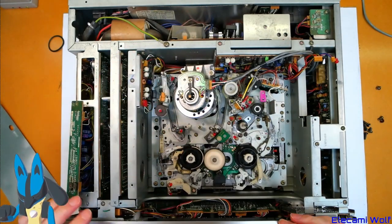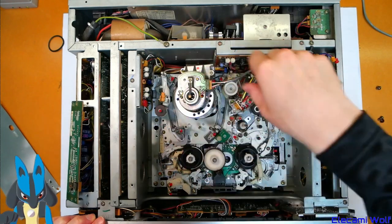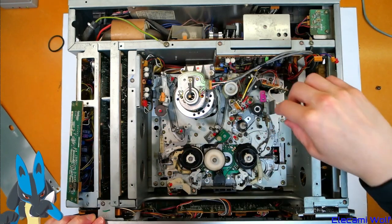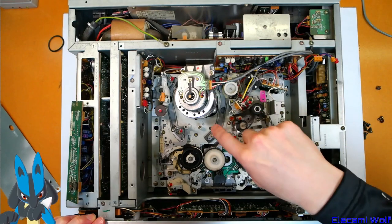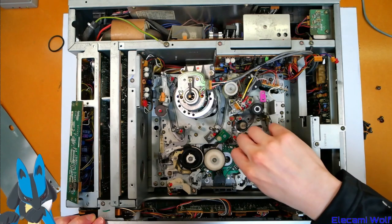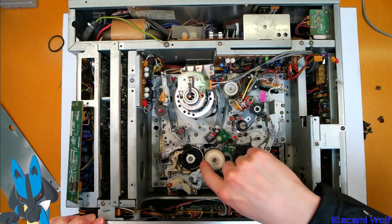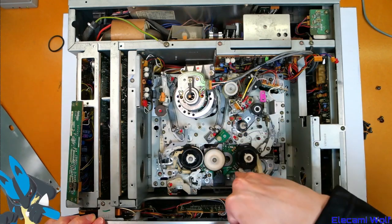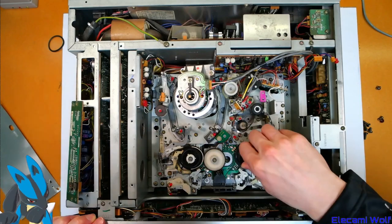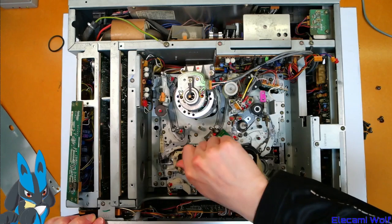The mechanism is now displayed for working on. This seems like the same base mechanism used in a lot of the other early 80s consumer VCRs — same shape head, same type of idler. There are hall sensors on there — or are they IR reflectors? Not sure. Those tell it what the reels are doing, which is part of knowing the real-time counter and time remaining.